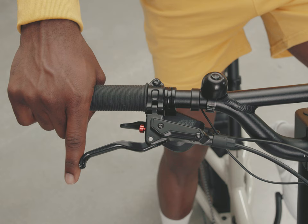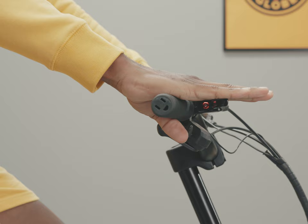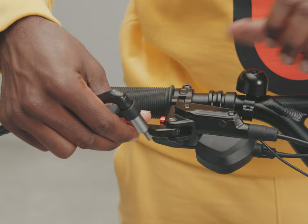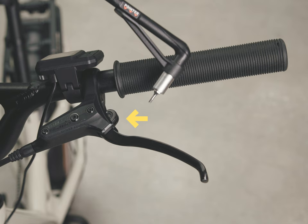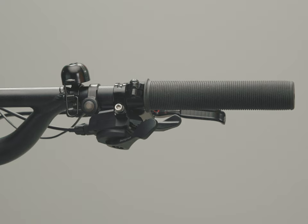Find the perfect fit and reach for the brake levers too. Hydraulic brakes are pretty strong — you don't need to use all your fingers to pull the lever; two should do it. The lever should be in line with your fingers and forearm. You can also slide the lever clamp over so you don't crush your other fingers while pulling the brakes. And don't forget the reach — use a small hex key to bring the lever closer to your grip. Lastly, make sure your thumb can easily reach the shifter paddles.